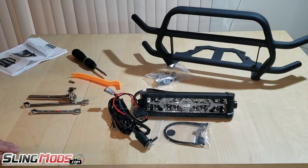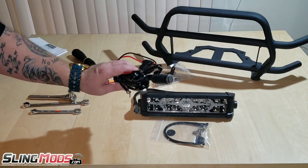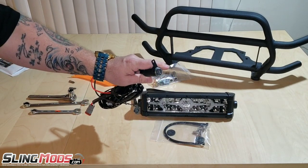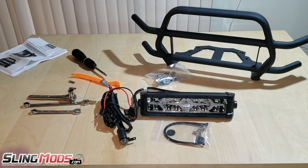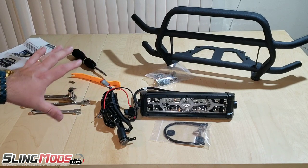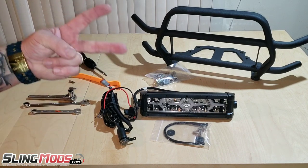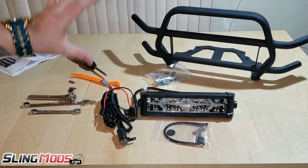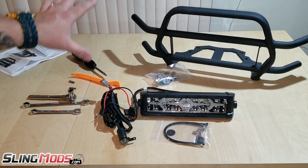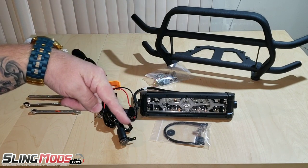This is a really straightforward design and a straightforward install. You got four bolts underneath for the grill guard, two bolts in the front end for the light, this wires to the positive and negative terminal on the battery, and one bolt up on the left-hand handlebar. Very simple install. Big shout out to Sling Mods — go check them out at slingmods.com, there's a link in the description. You can purchase both items as a set. Big shout out to those guys for sending this out and giving me the opportunity to do an installation for my fans on YouTube.